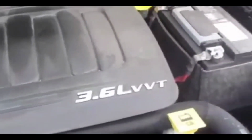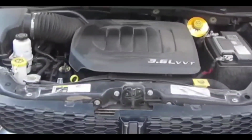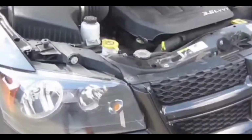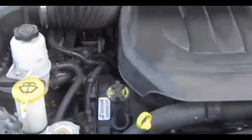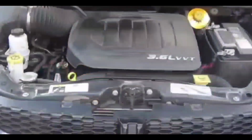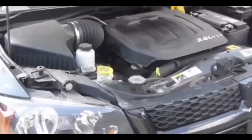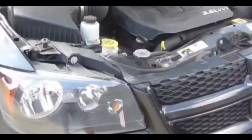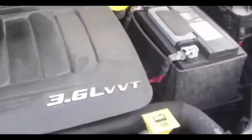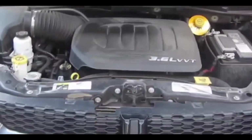All right, now with a situation like that, normally you would have a battery that's about to either go out, a battery that wasn't charged up by the alternator, and it leads to the battery going out and the car not starting or running until it dies out. Or you have an issue with maybe corrosion on the ground cable, or corrosion on the positive and negative cable. But 99% of the time, if you have this issue, it's because you have either A, a bad battery, or B, corrosion on the positive and negative cable.